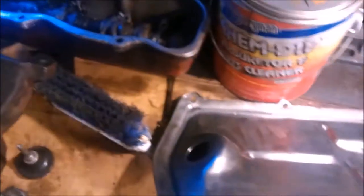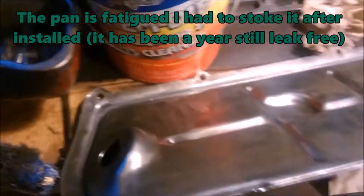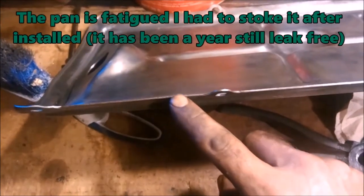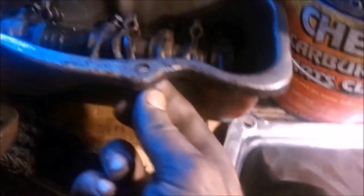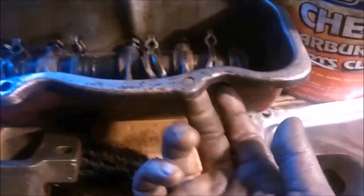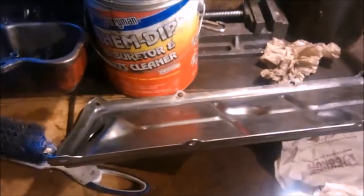We're going to clean up our pan. These bolts — what usually happens is people over-tighten them trying to stop a leak. The gasket gets hardened and whatever. You'll have to take some of these here on a straight flat surface, grip them, and give it a little straighten out. You'll notice these will be bent because someone tightened them down and the rest stays. In areas where we can't use pliers, we'll have to use a socket like a dolly and hammer it down against an anvil or vise surface to straighten it out — otherwise it's going to leak.